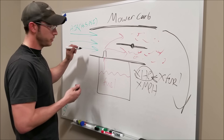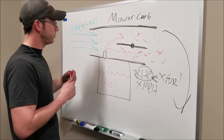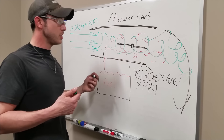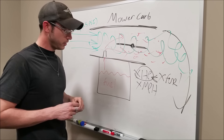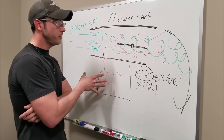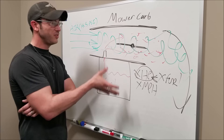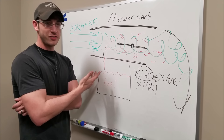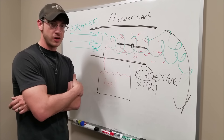Any fuel that goes through the engine in a liquid state is just wasted — that's where you lose a lot of efficiency with a combustion engine. In this case, we're atomizing this fuel so well that we're getting the same power content out of a lesser amount of fuel. It takes less fuel to get that same gas-state volume we need to make the horsepower. To make this even better, and mildly unintentionally, I cut a hard 90 on that intake, and there are two hard 90s going inside on the air filter side. This creates a lot of turbulence — it's an old trick. Not great for high-flow max performance, but as far as atomizing fuel content, it works like none other. We've essentially accidentally made something similar to a vapor carburetor, although it's pretty responsive where a vapor carb kind of has trouble keeping up with load.